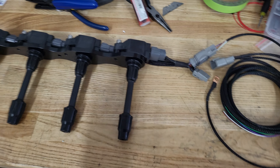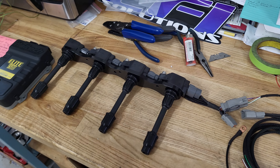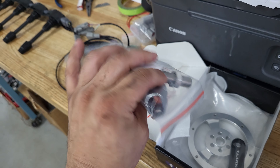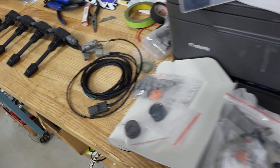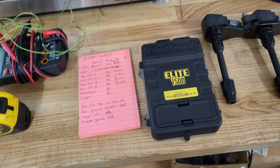We might come out with a kit to make this process as easy as possible, because if you don't know what you're doing wiring-wise, it can be a big undertaking and easy to make mistakes. If you're interested in a kit, just let us know. We don't have the wiring loom for the trigger kit yet, but it's going to be pretty much the same thing — we'll make a sub-harness that runs straight to the ECU pinouts, so home and trigger will be all dialed in to the Haltech.